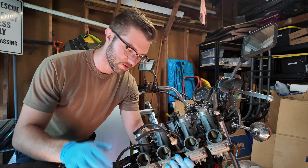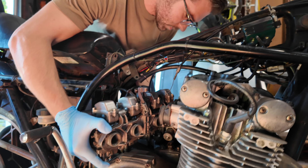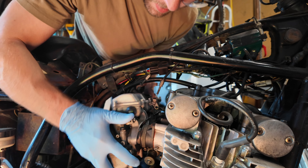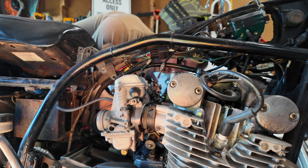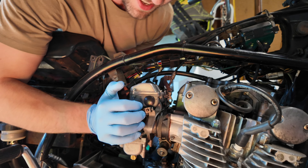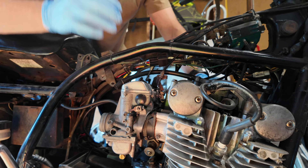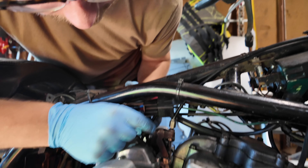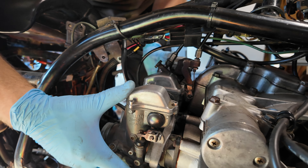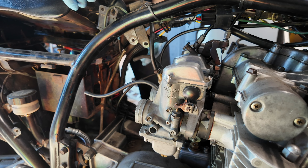Okay, time to slide these back in. Jeez, I'm going to immediately tear my gloves. Do you remember — the speedo cable goes around like that? Yeah, it goes around like that. I can hear the tips already: heat up the boots and it'll make it easier. It's already almost 90 degrees outside, I'm already dying — these boots are new. Throttle cables are now in after some finagling, they just need to be adjusted still but we can do that later.